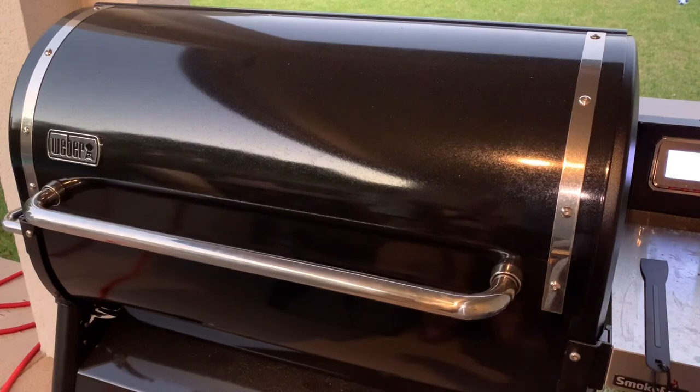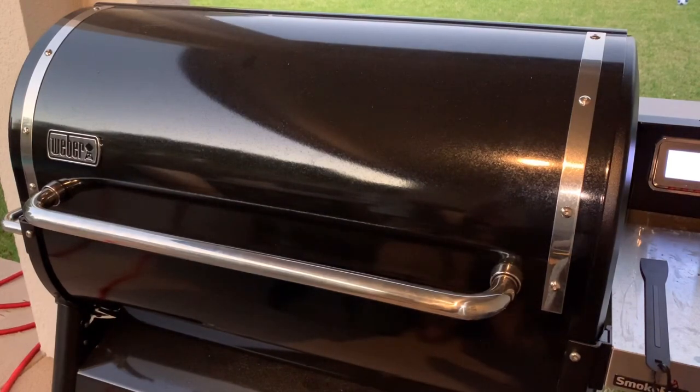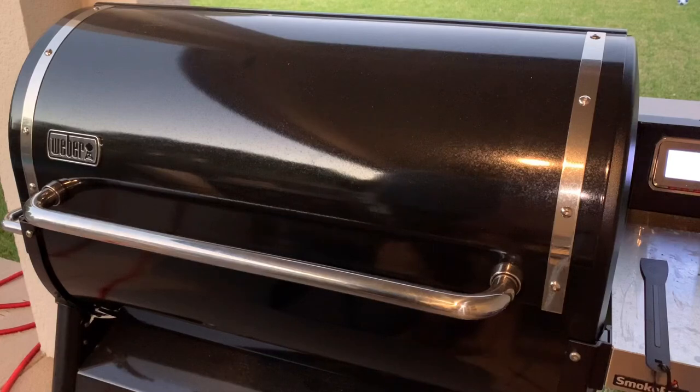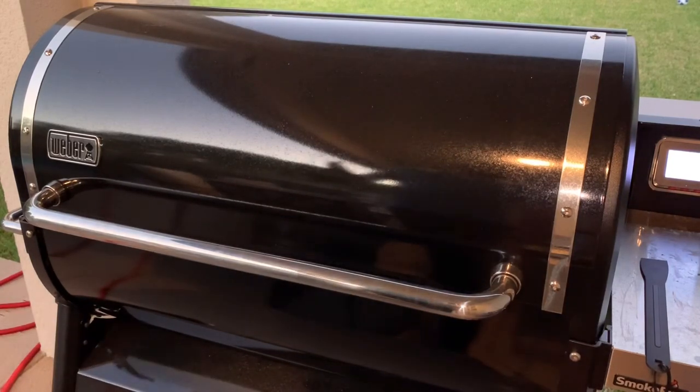So it looks like I have to vacuum the fire pot. It looks like the ashes and the pellets, when they burn at the end, go through the holes in the fire pot and stay there, and something happens so that the air maybe is not circulating correctly. Same pellets, I don't know what's going on. Most likely it's that. Look, it went up to 495. Okay, hopefully, but we haven't got to 550 and it's been running more than 20 minutes.